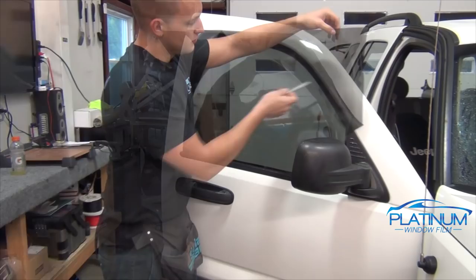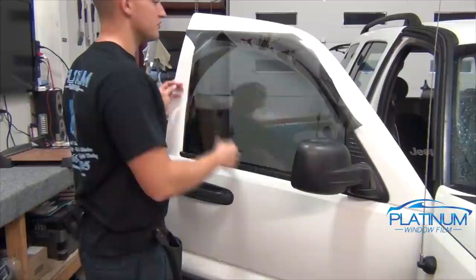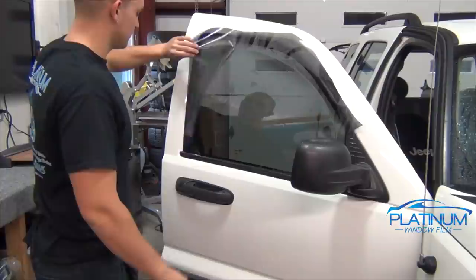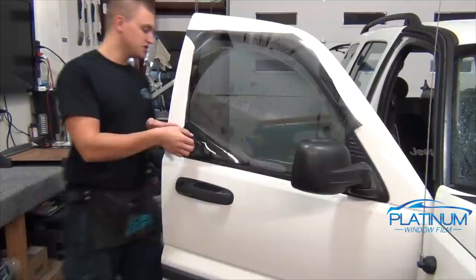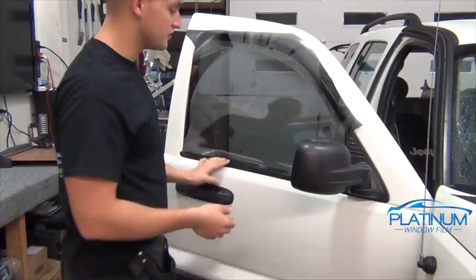You want to leave at least a half inch to an inch overhanging onto the paint so that when you roll the window down, there is extra film to cut off — you're not cutting into the window. Grab from the back, release the bottom from behind the gasket if it is behind there from shrinking, and pull it away. On this Jeep, we have the window switches in the center console, so it makes it hard for one person to do. So I'm going to show you one of my techniques.